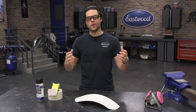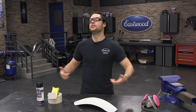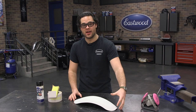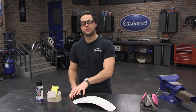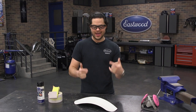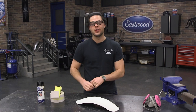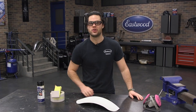After we took this out of the spray booth, we did give it a little bit of extra time. Our studio space here is a little bit chilly, so we think that made the drying times take a little bit longer. If your space was a little bit warmer, you can expect drying times to speed up a little bit. But what we have here is nice and solid, very dry, and looking pretty good. So what we're gonna do is put down a slight layer of guide coat, sand with the 320, move up to 400, and then lay down our epoxy.